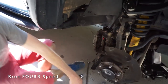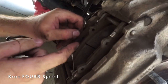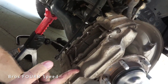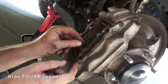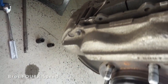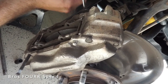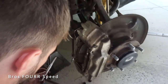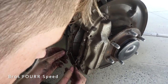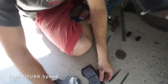This is pretty simple - the only other brake job we've done was brake pads on the GTR. We put the caliper back on to make it easier. I'm going to start by pushing this pin out of the back side - it comes out of the top bolt and the bottom bolt which hold the brake pads in. I'll use a punch and hammer to back these bolts out - just a little tap, nothing crazy. Now just pull the pads right out.